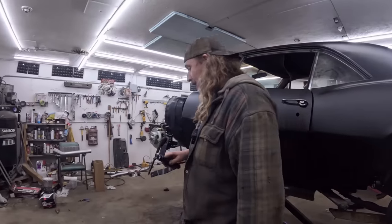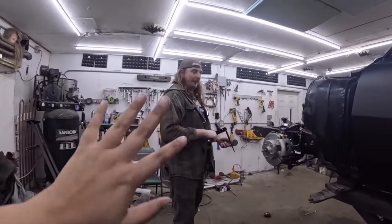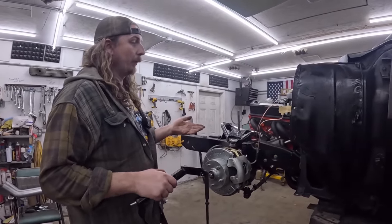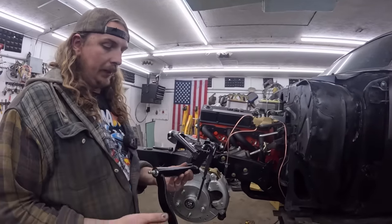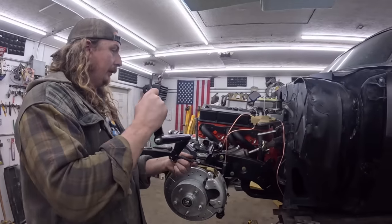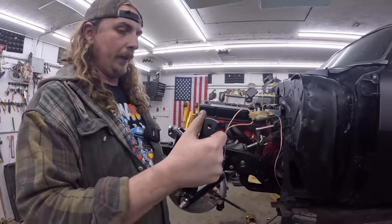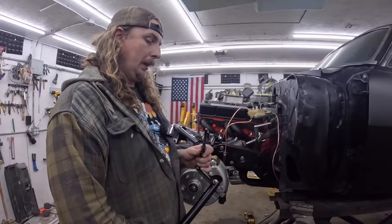Wow, look at all that welding we just did. It's all done. So now we gotta put this clutch deal in, which, I gotta say, is gonna be easier to show you with everything apart. This is the Z-bar, which will fit kind of something like that. We gotta jam it against the motor and slide this down on this little bracket. Then this is our adjustment for the clutch. As you step on the clutch, it will push this back and operate the clutch.